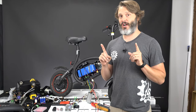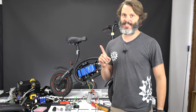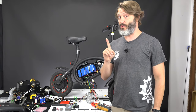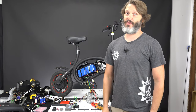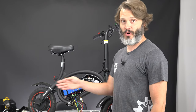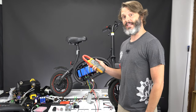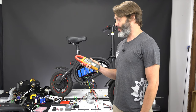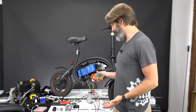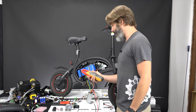Out of the 36 possible combinations, only one will run properly in forward rotation and only one in reverse. If you have a geared hub motor, you won't get reverse rotation because the freewheel just won't let it. Some combinations may spin in the right direction but with extremely high amp draw, which will end up smoking either your motor or your speed controller. I highly recommend a clamp meter or inline multimeter and be extremely gentle on the throttle so you don't smoke components. If I can get this working and tuned right, I'll probably end up selling these controllers ready to go for anybody who wants them.